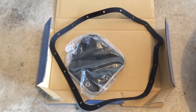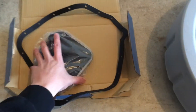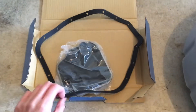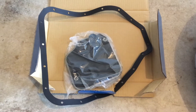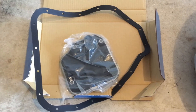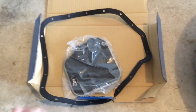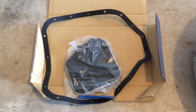The manual recommends a reverse flush. But after going online and reading about it, a lot of people don't think a reverse flush is a good idea. These filters get clogged with contaminants, so it seems like a good idea to just replace it. This kit comes with a gasket — if you don't get this gasket you'll need to use a gasket maker, putting a silicone bead around to seal it. I'm hoping this rubber gasket works. I got this from Rock Auto — I'll put links below for all the materials.